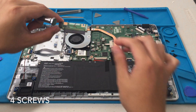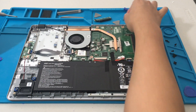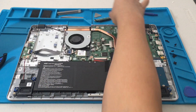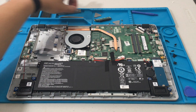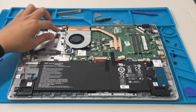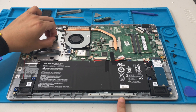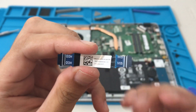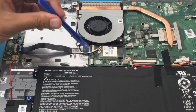For the caddy itself there are four screws. I removed the first screw — the connector is part of it — and here's screw number two for the caddy. It's really great what Acer did: they included the connector and the ribbon cable to upgrade or add an SSD. They included the screws for the caddy, the caddy itself, and the ribbon cable. Now that the caddy is removed, we just have to peel off this cable — I'm being very gentle because it's really glued on there. The cable is labeled MB on the right and HDD on the left — MB probably means motherboard and HDD is for the SSD or hard drive.